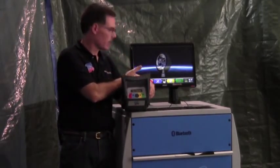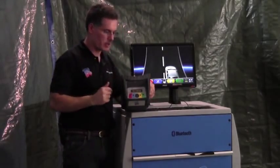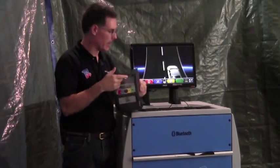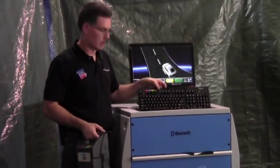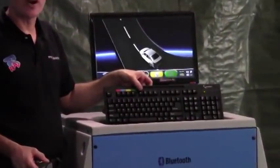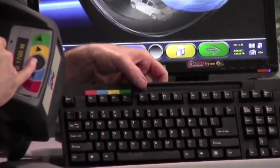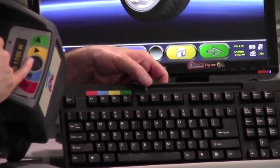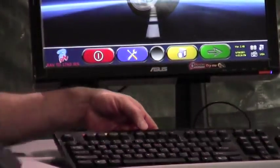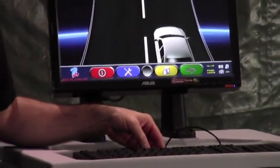So that's your basic navigation. All five keys on the sensor head are also represented on the keyboard. One thing to remember: the F5 key on the keyboard is your gray center key. So when you're navigating in the program and it's asking for a center key or has an option for the center key, just hit F5.